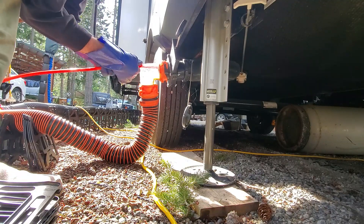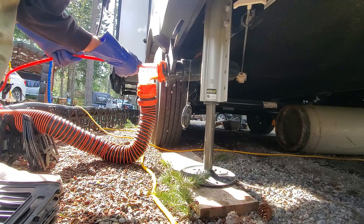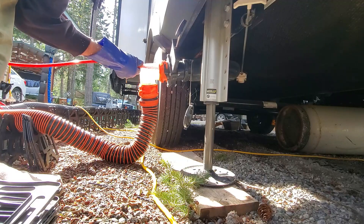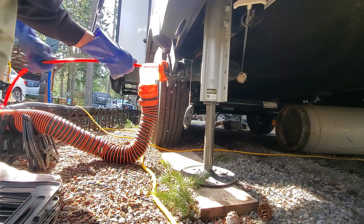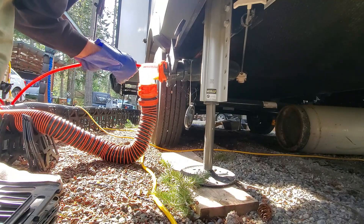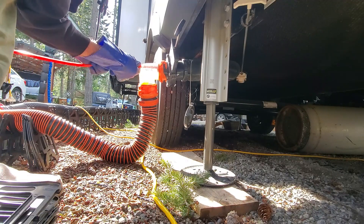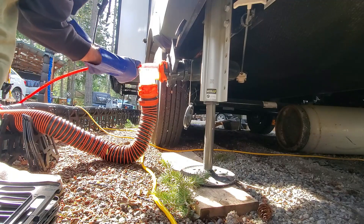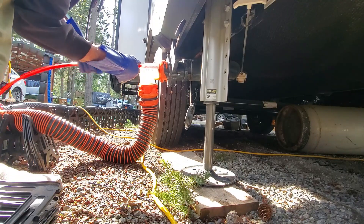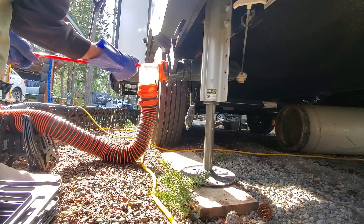This back tank typically showed no issues on the gauge — every time I dumped and drained the tanks it showed empty, but I'm getting some stuff out of it. So it's a matter of feeding and flushing, feeding and flushing, and rotating the hose. That's pretty much what you see is what you get — it's doing a decent job. The little pressure washer I have for the RV is small and compact, doesn't take up a lot of room, and it's still got 1800 PSI, so it does a pretty solid job for what I needed to do here.